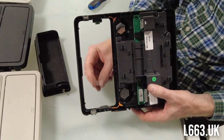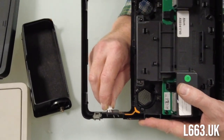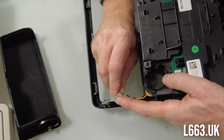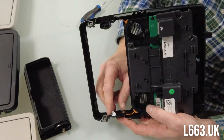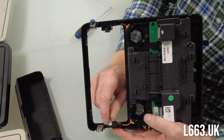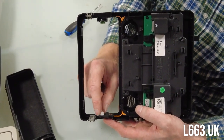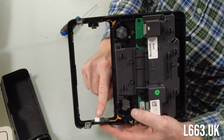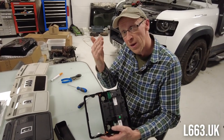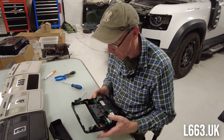The next thing we need to do is to put this little damper cog in this hole here - that should just pop in there. There you go - and that should be free to turn. You can put a little bit of white grease on there as well; most of them from the factory have a little bit of white grease, just to let it rotate freely. And that provides the locking mechanism - without that, it would just open and you'd close it and it would flop open again. That's the bit that gives you the sort of keeping-it-up action.